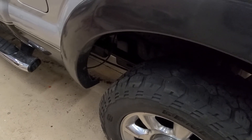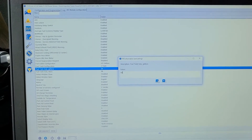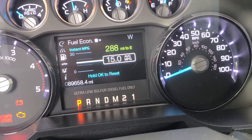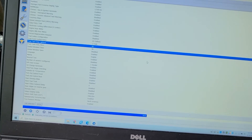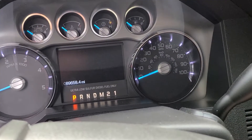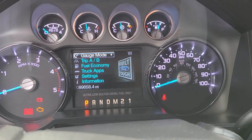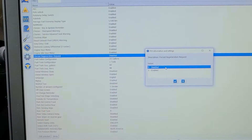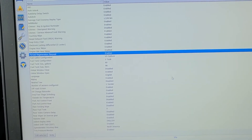I haven't had a chance to fill it up yet — going to do that now. But first I'm going to get the fuel tank updated using FORScan: go to the IPC module configuration, Fuel Tank, and edit that to update it with 60 gallons. Since we have about a quarter tank used, it's showing 208 miles until empty. I'm going to try writing this — and there we go: 593. Since I'm here, I'm also going to change the Forced Regeneration Request from disabled to enabled, which should allow me to use the diesel particulate filter.